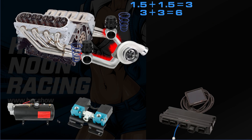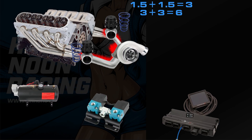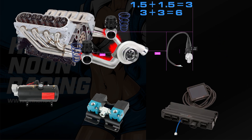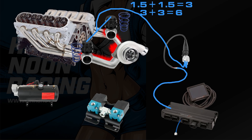What we use to control this is some sort of compressed air — it's called dome pressure. You can either use CO2 or compressed air. In this case, I have an air compressor, two MAC valves, and an engine ECU. We also have a pressure transducer which tells the ECU what pressures it's seeing. I have a line ran from both of the tops of the wastegates to my pressure transducer, so it sees the balanced dome pressure on both of them and tells the ECU the total dome pressure across both.